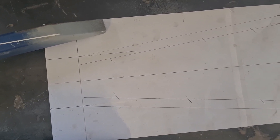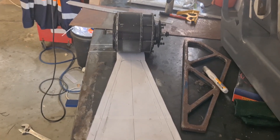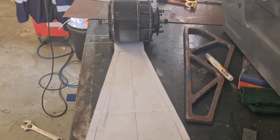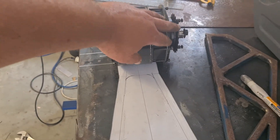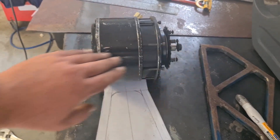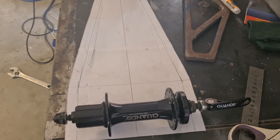It'll probably end up stronger and be lighter — at least that's the goal. I'm trying to get an idea with the hub sitting on the one-to-one pattern and the motor at the other end of where my chain line will be. The rear sprocket goes on the disc brake mount on the hub, spaced out a little. I should have a reasonable chain line. I do have room to space the motor sprocket in either direction. This is just a placeholder — the actual sprocket will be different — so I have the ability to shift it in or out if needed.